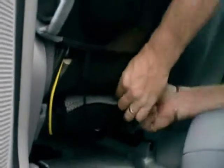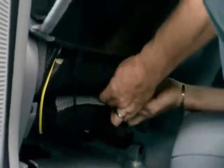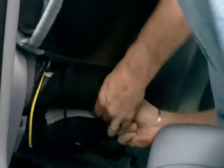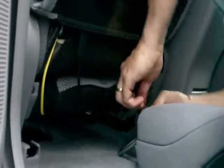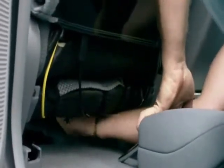And then here again, I take hold of the seat cover itself, not the elastic, and I pull it nice and tight. That sucks it down in the middle. Put the hook on, reach underneath, give it a nice tension, and there we go. Now let's go take a look at the front and see how it looks. Ready? Okay, yep. Okay, so what you see is it has tucked itself down. We have a nice little contour here in between the bolsters. That's what you want. So you got your cushion on, you got your backrest on. Next thing we do, the headrest.